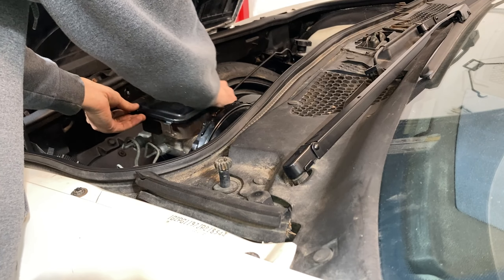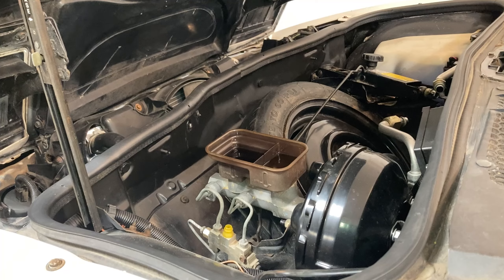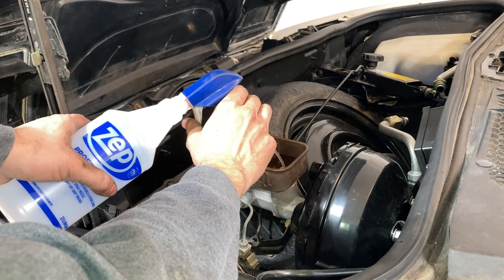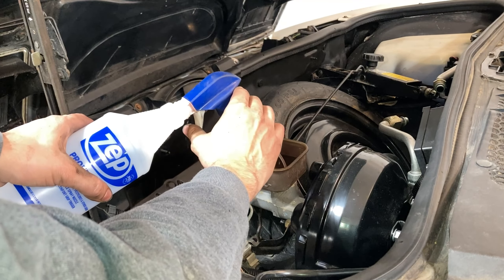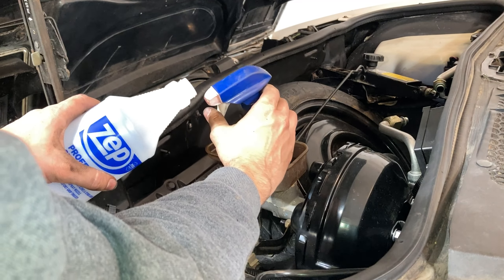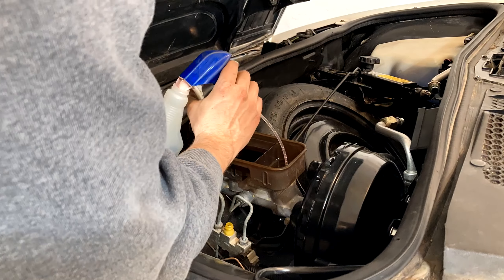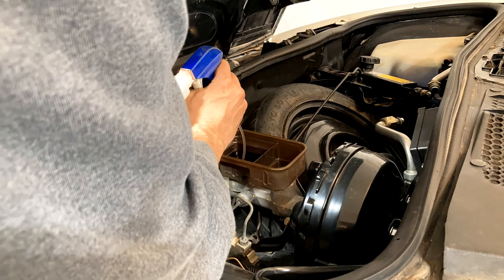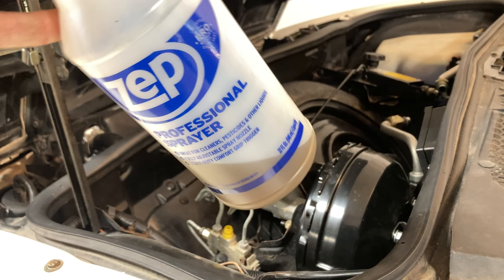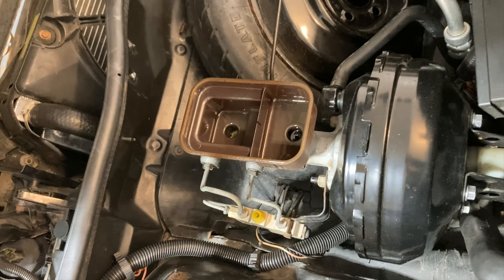If you want to speed up the process of draining, you can go ahead and pop the hood and take the cap off of the brake master cylinder. Since I'm flushing my brake fluid, I need to get rid of as much as I can up here. I'm going to use a spray bottle to spray it into the bottle. Try not to get any brake fluid on anything because it could mess up the paint. Over time brake fluid can absorb moisture, which actually leads to loss in performance — it's recommended to change this out regularly. You can see here that this fluid is pretty dark in color, meaning it's pretty old. The front and the rear brake lines are supplied with slightly separate reservoirs. Empty both out and bleed them all the way around the car.